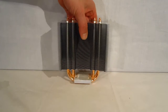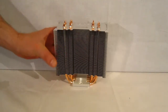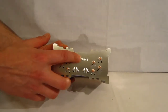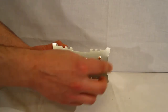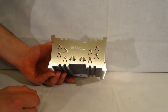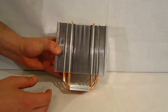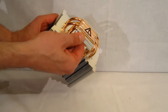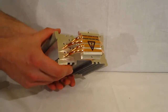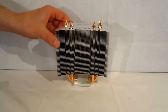Taking a look at the tower — very nice tower, all aluminum fins. Interesting design up top with the Enermax logo blazoned into the top. Four heat pipes coming through on both sides. As you can see, it is actually directional, with arrows pointing which way it's going to blow. Down the bottom, contact block — nickel-plated, four direct contact heat pipes, six millimeters. Nice thick design. Very nice looking tower from Enermax.